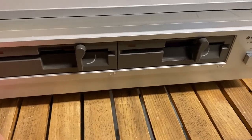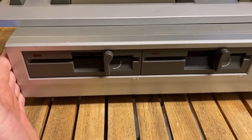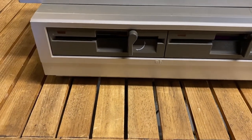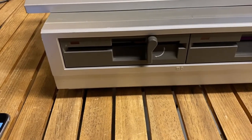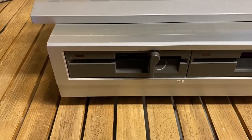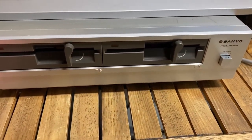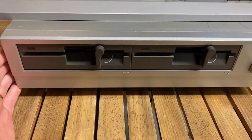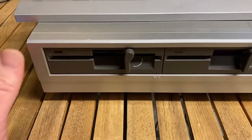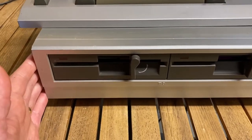This is a very early clone, designed in 1982 and retailing from 1983 onwards. It has custom hardware — it doesn't support standard anything. It has a character set in ROM which is custom to this machine, a custom video mode, and custom video circuitry not supported by standard MS-DOS. It's definitely not IBM PC compatible, so if something bypassed standard BIOS routines for text drawing — meaning most any IBM PC program — it wouldn't run on this. It's highly incompatible.